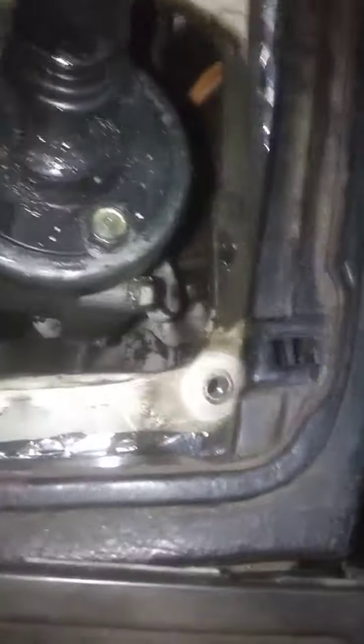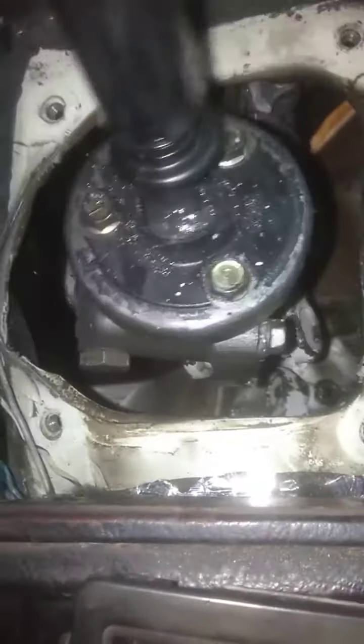This is what it looks like. This is the shifter — all of that is not supposed to be moving like that. If you look down on the inside, that's my driveshaft. It warped this whole tranny tunnel. And this is what it looks like from underneath. Transmission's still good besides the top shifter bracket. Everything else still looks pretty clean. Just destroyed the heat shield and blew out the driveshaft, but other than that, she's still good.